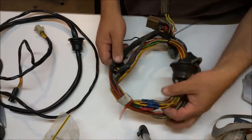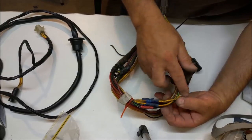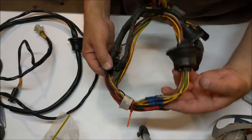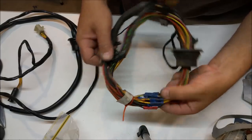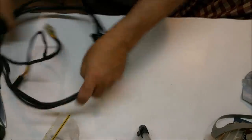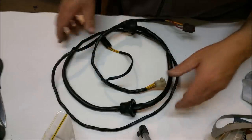But anyway, if you're going to cut looms, you don't cut them all at the same spot. You stagger the cut, so you've got shrink tubing staggered. But maybe there wasn't space for that. That looks to me like the guy's just a lazy bastard and a bit of a dodgy individual at best. But well, what do you do? So I'll go ahead and do those. Then I'll lay it in the car. Might just clean up a bit more.